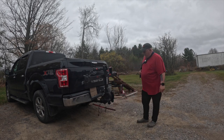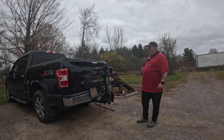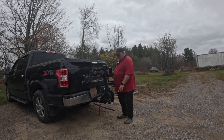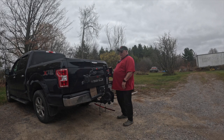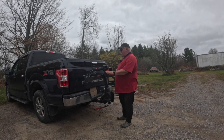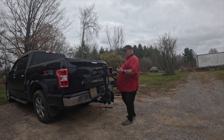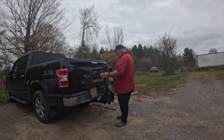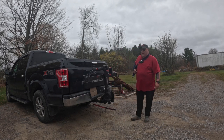A few LEDs were burnt out on that rail, so I've ordered new lights. Instead of using a steel bar across the lights like before, I've got a piece of aluminum that I'm going to notch out — it'll go in behind, drilled so the bolts can slide through, and the lights will be attached to that aluminum piece.